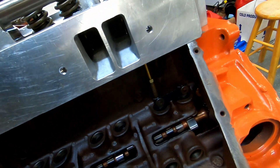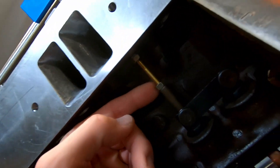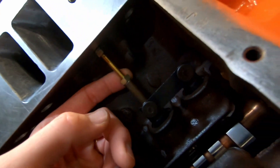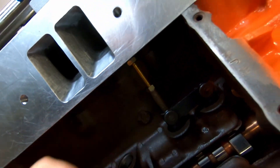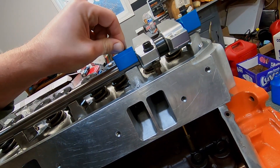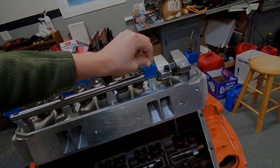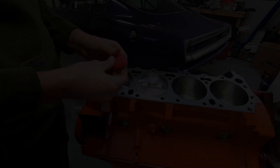I'm also going to be checking my push rod length. I made myself a homemade checker here — basically it's just a push rod that I cut into two and put a piece of all-thread through. We'll see if it's strong enough to cycle the engine over and check that piston-to-valve clearance. Let me pop the head off real quick — there's more to discuss.